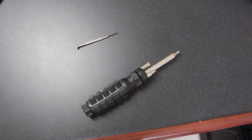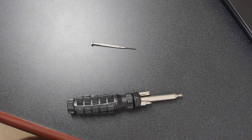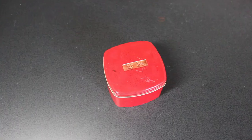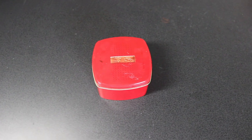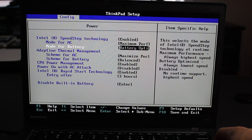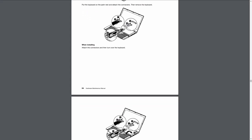You'll need a Phillips-head screwdriver, a smaller screwdriver for the keyboard, a flat tool for prying the chassis open like an old gift card, and preferably a tray to hold your screws — I'm using the lid of an old T-Tin. Before you do anything, make sure to disable the internal battery in the BIOS so that your computer is not powered. It's also a good idea to consult the hardware maintenance manual — I'll leave a link in the video description.